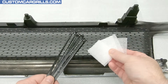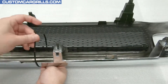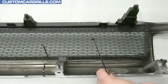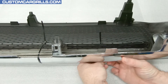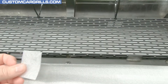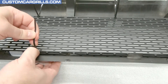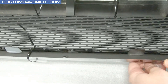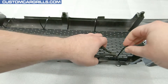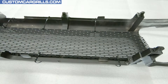Next, I'll grab some cable ties and foam. The ties will help keep a temporary hold of the mesh to the grill, while the foam will help protect the finish of the grill from the tension of the ties. Wrapping the ties on is easy — the tail end loops around the grill and through the mesh, and the head of the tie should fasten on while resting on the back of the mesh. I just need to get the mesh to hold up tight against the back edge of the grill. There's no need to over-tighten the ties, because that might distort the shape of the grill or damage the finish of the painted areas. Once the ties are in place and I'm satisfied with the fit of the mesh, I'll cut the tail ends off and throw them away.